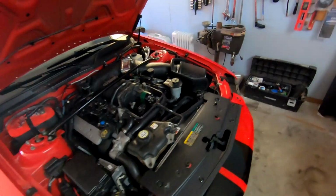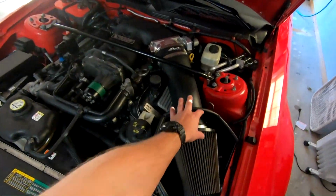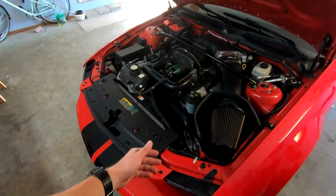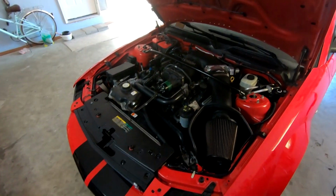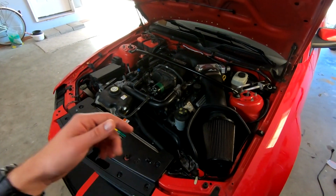So for now, I'm just gonna go ahead and pull out the alternator. It's nothing too crazy. We've got to pull off the intake just so we can get down to the top bolts and then jack the car up, and we got to get underneath, take the belt off, alternator out. Super easy. I don't have a sway bar in here, which is even easier, but I will run that through with you guys in a minute. So let's go to it.